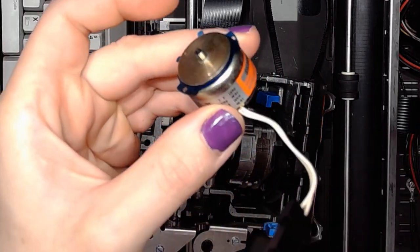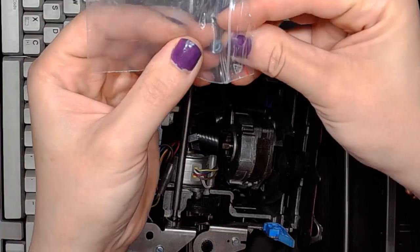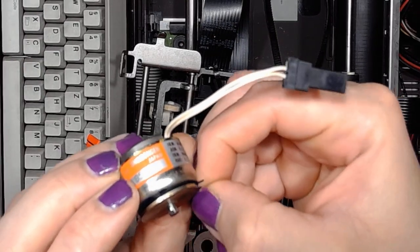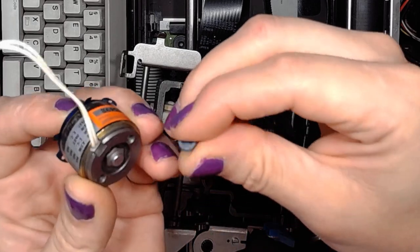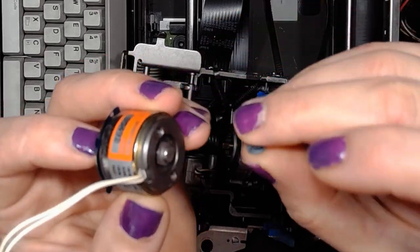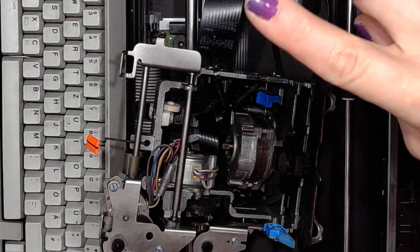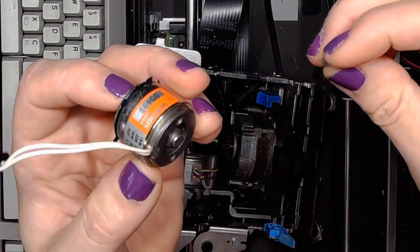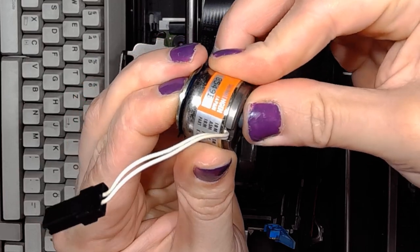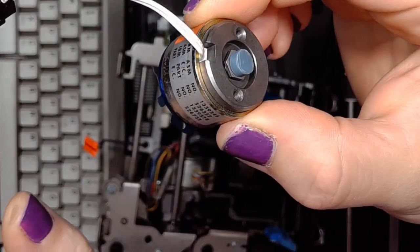So I've got the solenoid, and I've got the shim, and it was also a good thing that I tried to design a new one, because it turned out that I got this diameter pretty wrong. After I took the solenoid out again, I discombobulated the carriage mechanism again off the camera. I measured it with a vernier caliper, and this time got the dimension pretty much right. And we're gonna see where it takes us.